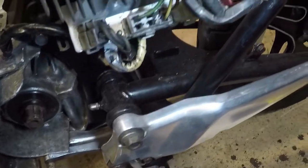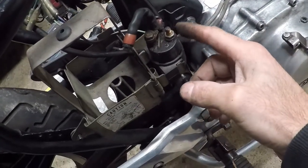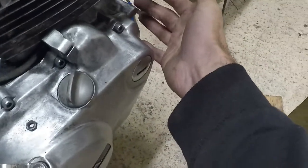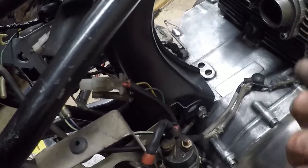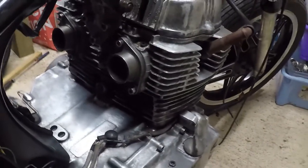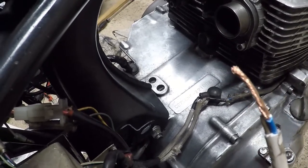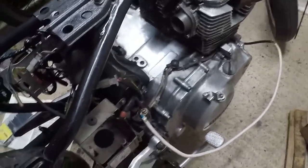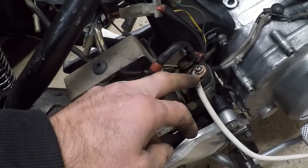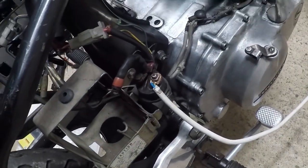Those four connectors are all on, so I think this side's good to go. I don't have the cable that goes from the starting solenoid through to the starter motor. Because it's late and I'm getting impatient to see if I get anything, I'm going to take a 13-amp mains cable, take all three cores and twist them together to give me something which stands half a chance of carrying the amperage of the starting motor - just for tonight at least.